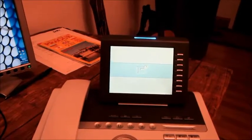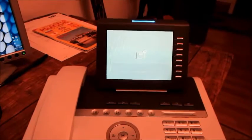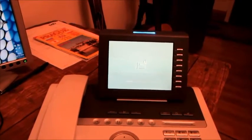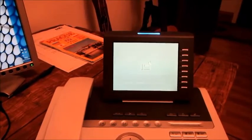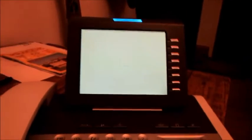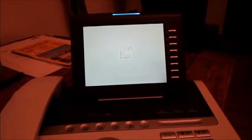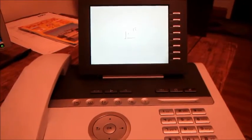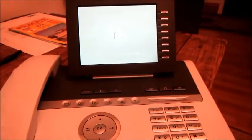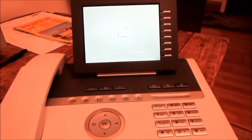What you're going to need for this is the phone plugged into a broadband network and another LAN cable to your computer that you're going to set the phone up with. It's also helpful to have a phone nearby so that you can actually call yourself and test that both lines of communication — outgoing speech and incoming speech — are both working. You're also going to need a SIP VoIP provider, which is really simple — you can go online and set one up with a credit card in a few minutes.